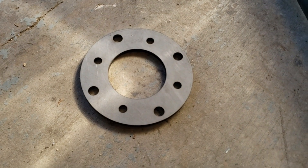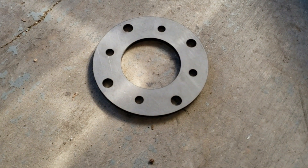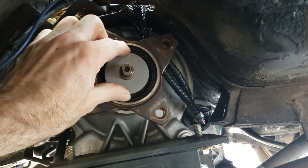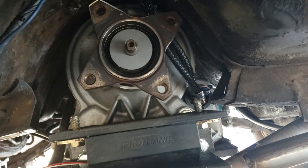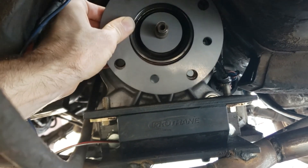The reason I have to do an adapter plate is because I cannot find the right yoke to go from there to the drive shaft — because of quarantine stuff — so this is what I figured out. It slides right over this perfectly, just the right amount of movement, and it will self-align the hub. This guy will fit over that just like that.